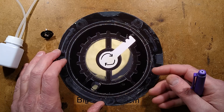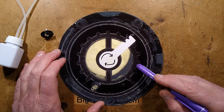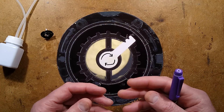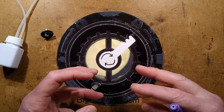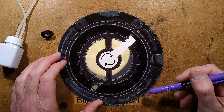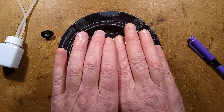The liquid itself is complex in its own right. The speed at which the pump delivers liquid is important, the vacuum effect is important, and the shape of this piece is important for sweeping the liquid round. The bubble liquid itself is mainly based on water with a surfactant — probably cocamidopropyl betaine, or it could be sodium lauryl sulfate, which is what you find in shampoo. The surfactant molecules can combine onto oil and water, but because there is no oil here — and oil really ruins bubble fluid — they just join with their water bonds, forming a skin that as the air blows through it, closes up and creates the bubbles.